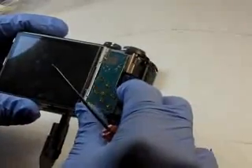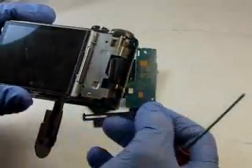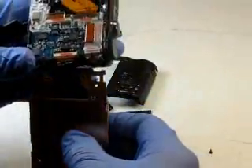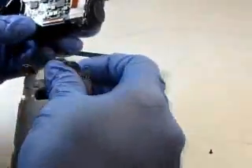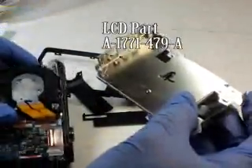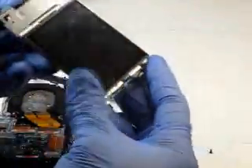The option panel here we're going to just flip it up and out of the way for now. Now we're going to move the LCD and the back plate assembly. You're going to need to carefully pry off this plate here, and then just kind of open it up. There's a ZIF cable clamp — we're going to flip that up and remove the LCD. At this point you can replace your LCD with the new one just by removing it off of this back plate.